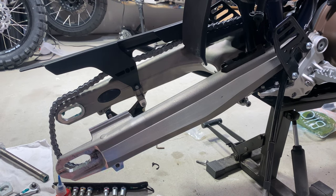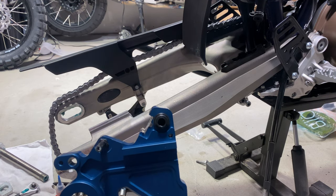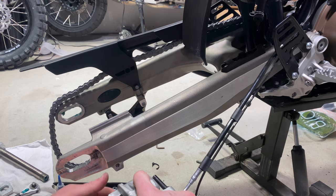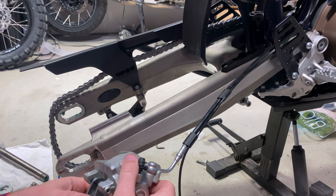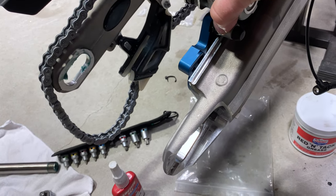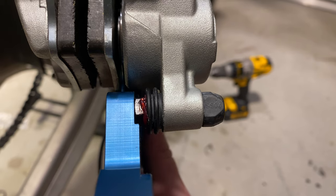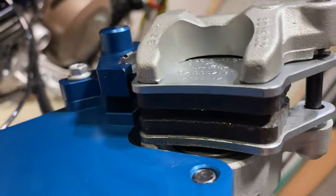So now we have our shark fin with the brake clip. We've also transferred over the rubber piece, and then we've screwed in this carrier bolt. So when you go back over to your caliper, you'll still have this bolt up top remaining, and you'll have everything else you need to basically transfer this right over. Now you have this affixed to the caliper. We have a little bit of grease there, and we need to pull that fitting out over that bolt. The clip is in, the brakes are in, and then this clip over here is pushed in.